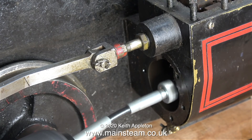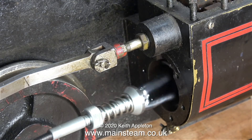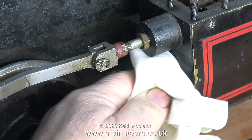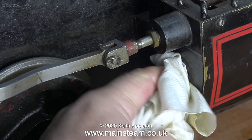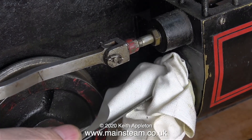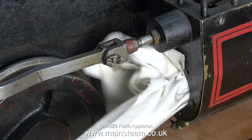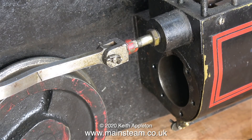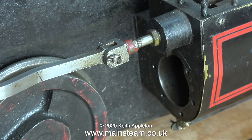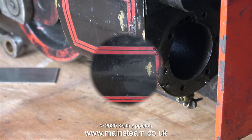The other side are okay — I noticed some drops of oil from the other side. This honing process takes quite a while because this cylinder is in very bad condition. But I'm not just honing away wildly and relentlessly. Periodically I clean out the dirty oil from the cylinder and replenish it with some clean oil. Here I'm using a cloth which I push through the cylinder with a ruler, because if I use my finger I may cut it — look, it's quite sharp on the edge of these cylinders. And by the look of the cylinder from this end it needs some more honing yet.